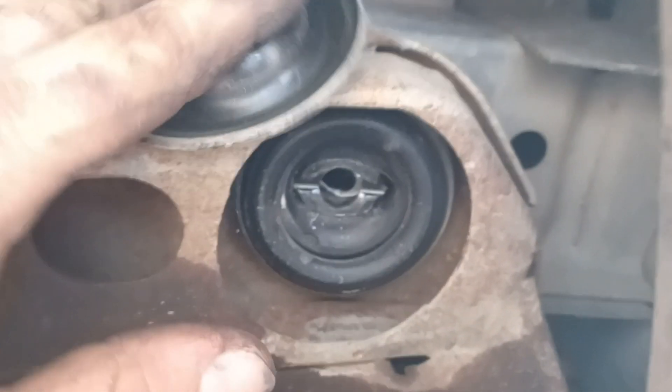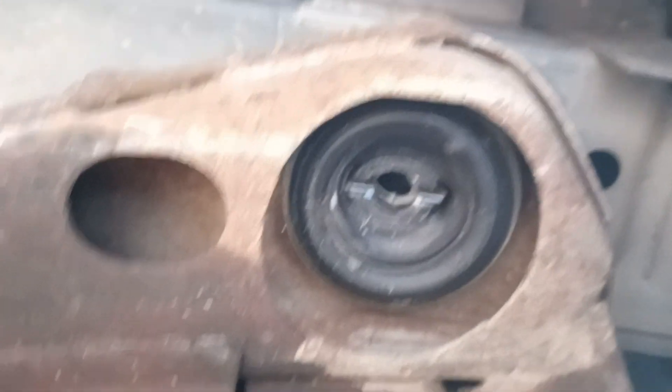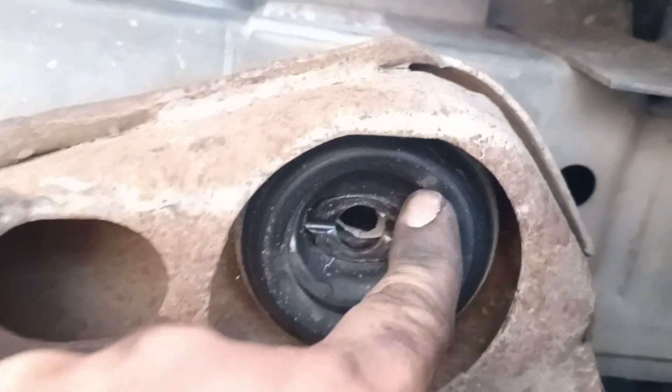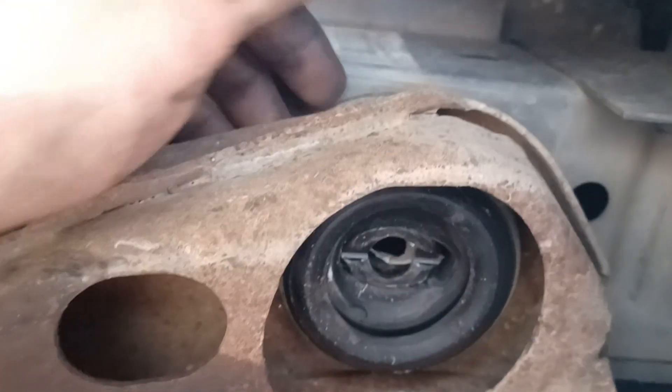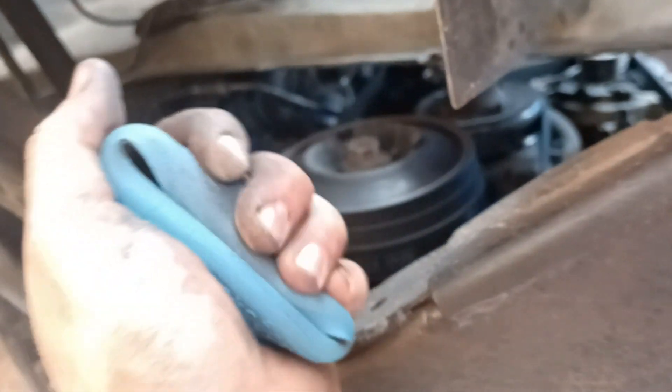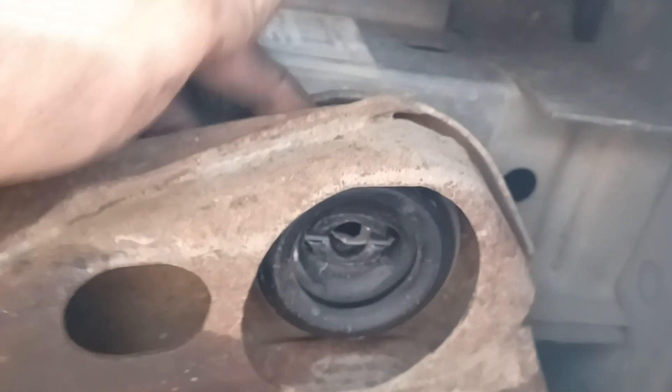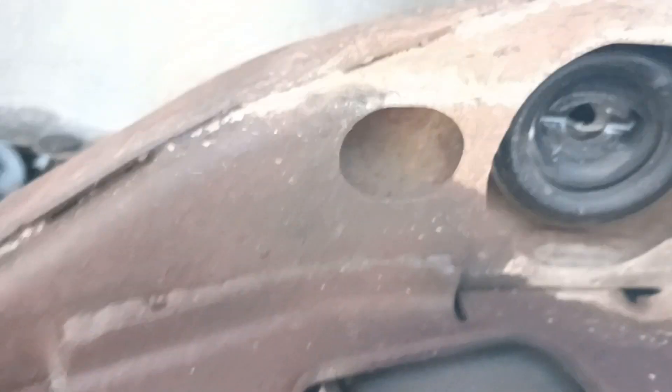You have to jack it up or let it down as you need it. You just take this out — these are some pretty long bolts — and your flat washer will come out with it. These front ones on top are fine, just like the back ones were fine. The top one, however, is harder. These ones you can crush and move around, but the others you can't hardly push in, and that's where I'm getting a lot of body vibration.